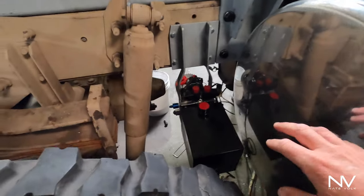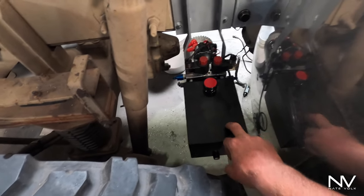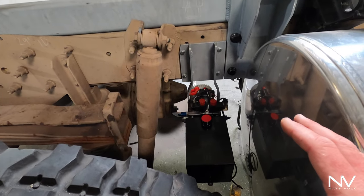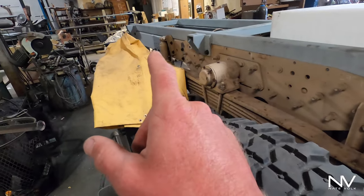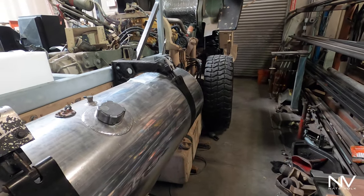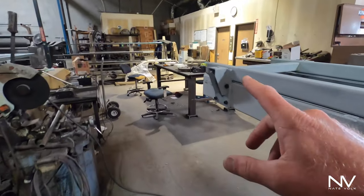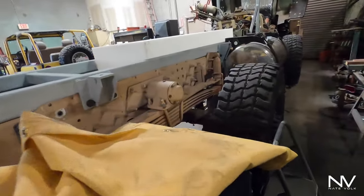I mounted my hydraulic pump down here in a little dead space that's not being used. This is a standard 12-volt, 3,000 PSI hydraulic pump — that's where it's going to live for now, it's not in the way. I'm not sure what I'm going to do with the spools — I might run them back there and put them in a cabinet or run them up here in a cabinet. I'm going to have six levers on that spool: one for the cab tilt up and down, one for each corner of the habitat to level it, and one for the back which will have a lift gate for the motorcycles and spare tires. All that's going to run off this one pump.